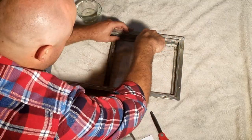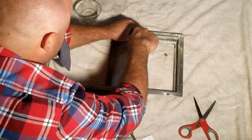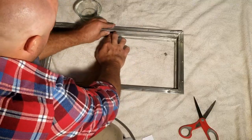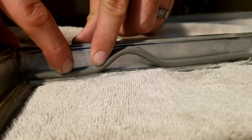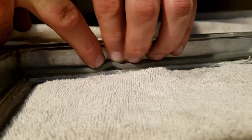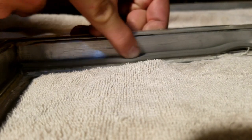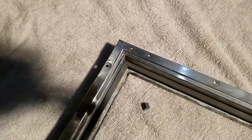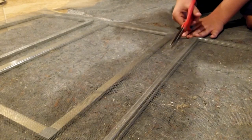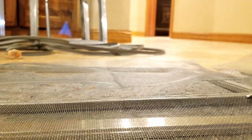The next step is installing the gaskets, which are the second point of entry for leaks. Make sure your orientation is correct. I spread a little oil on them during installation and made them a little extra long, leaving a slight hump at each spot. One common failure mode is inadvertently stretching the gasket as you install it — it sits in a stretched fashion, and then after a couple months people think the gaskets shrank. Really, the gaskets just relaxed back. So make sure you make them a little long to avoid inadvertently stretching them.